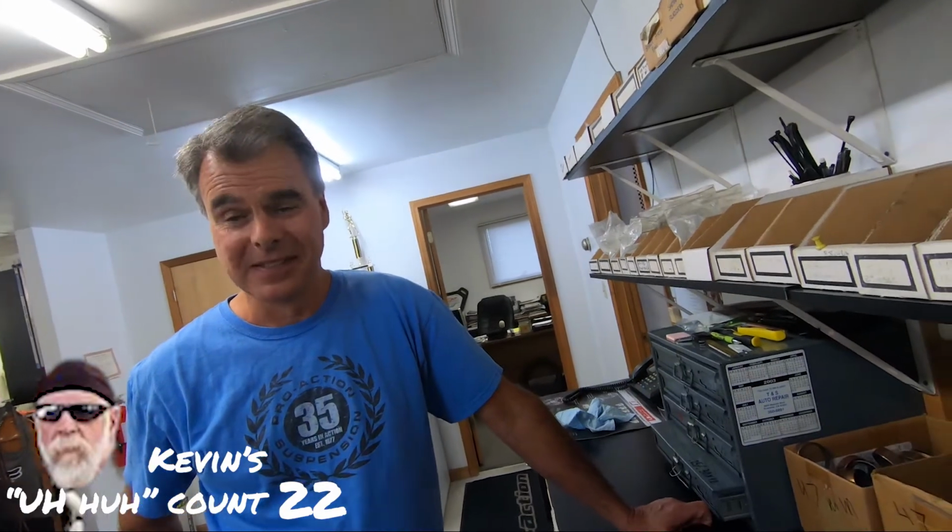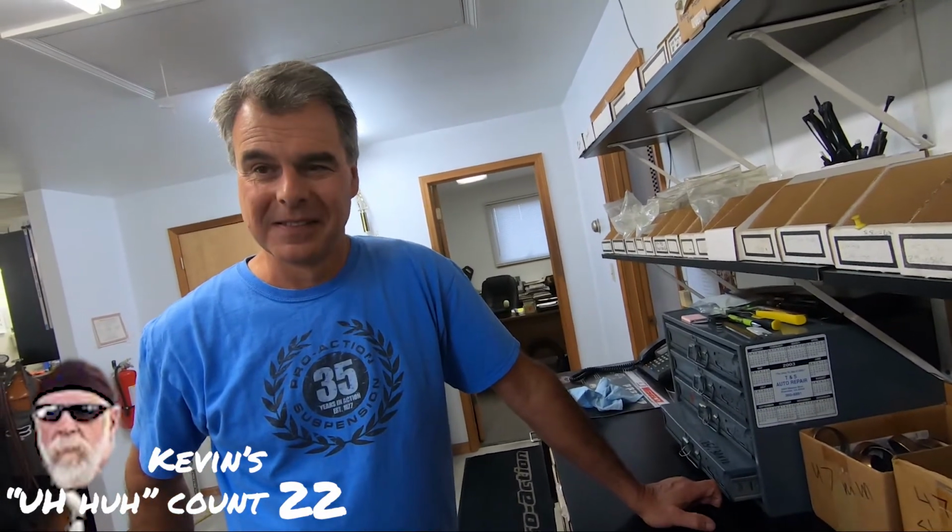I can't tell you how many customers we've had. We send them set up, and they start playing with it, which is fine. It's their bike, they can play with it. But they should play with it according to the instructions. They do exactly that. They get more and more sag, and they're going, it feels stiffer now. And I've lightened the preload. Well, that's because they've bypassed.